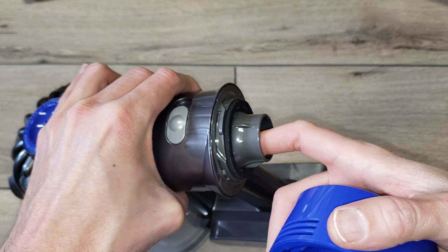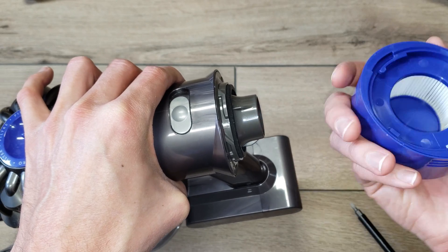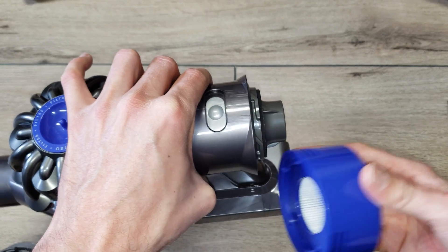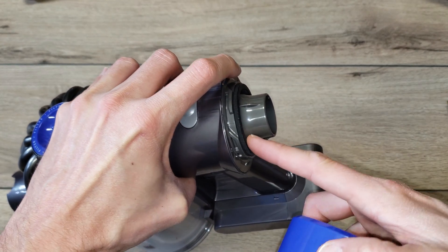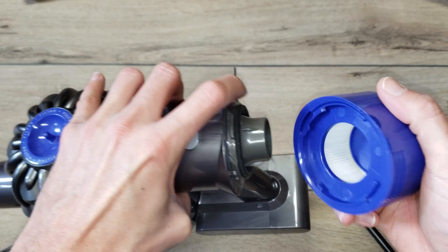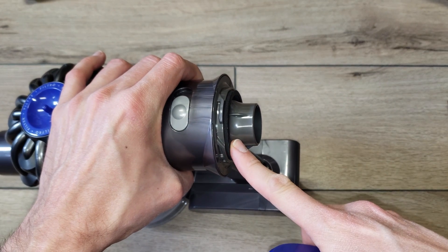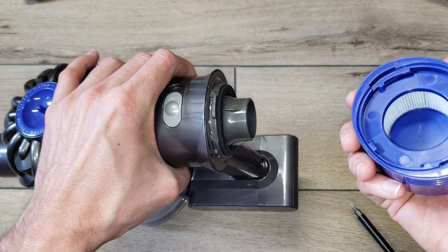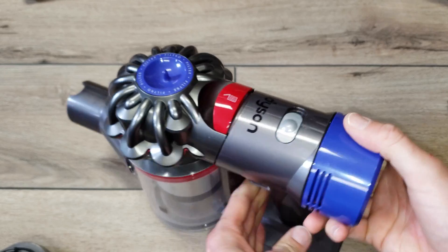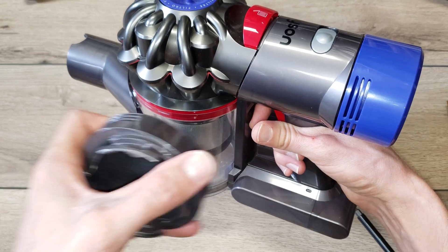What's interesting is how long this tube is here. I'm not sure if there's a reason for that length — maybe it's for sound or something — because it goes pretty deep into this, deeper than it seems necessary. Versus if it were cut shorter it would be less restrictive and allow airflow to distribute more rapidly. But I suspect they just modeled it right off of the Dyson one. And the last step of this HEPA retrofit is just to snap on the HEPA filter. Now we have a retrofitted Dyson V7 or V8 with a HEPA filter in place of the original foam filter.